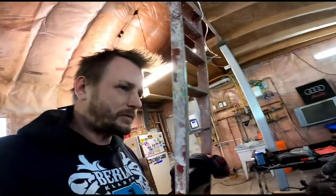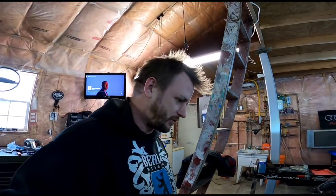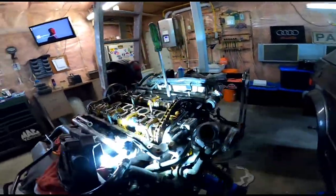So I'm going to torque them down. It's like 10 newton meters, I think. Bust out the torque wrench, torque them down, and then that is done. The cam is installed and the gasket is changed and all that. So that's good. I'm going to set it up, torque them down, and then I think that'll be it for this because I'm still waiting on some other stuff.